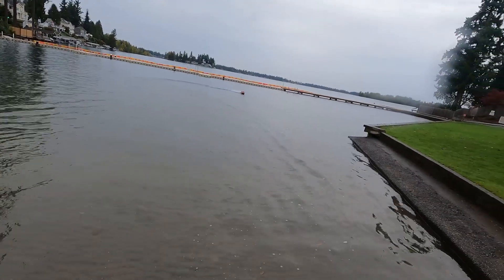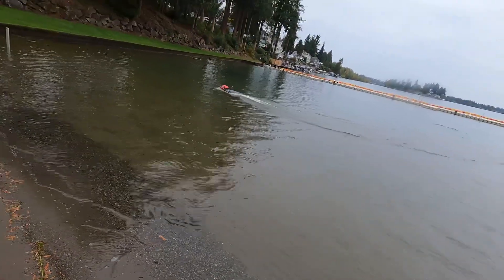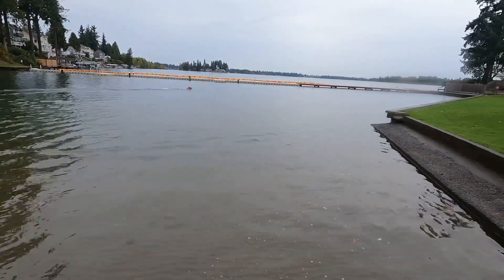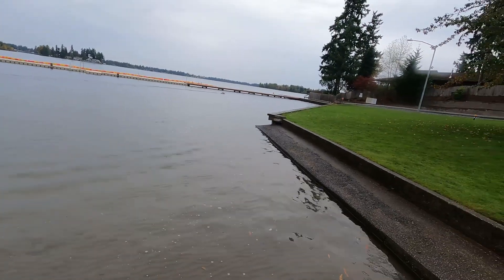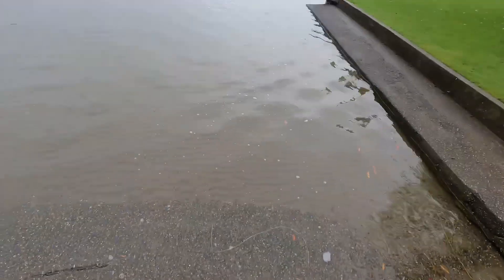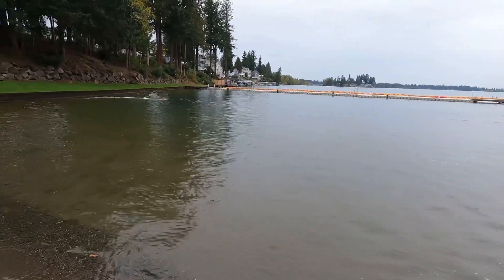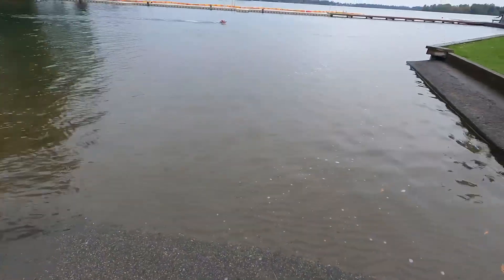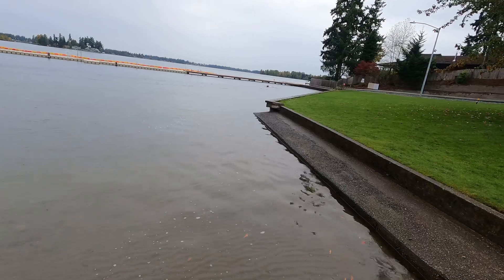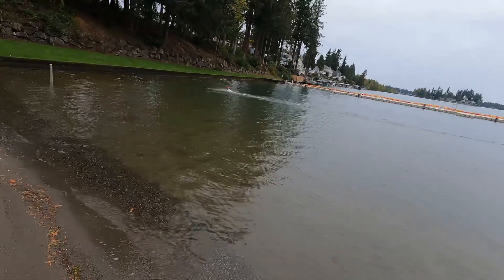You can see the controllability — just having the nozzle a little bit down. Bringing it back up to a more positive, neutral position — you can see how much jumpier it is. Then nozzle down smooths it out a little more, keeping more of the boat in the water. Bigger stuff it'll still jump, but it's much more manageable.